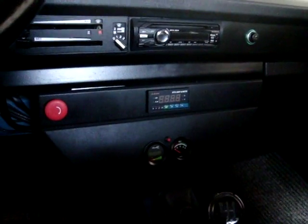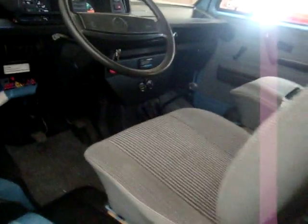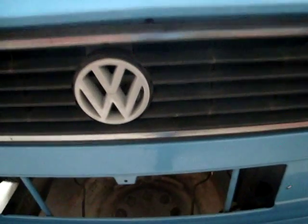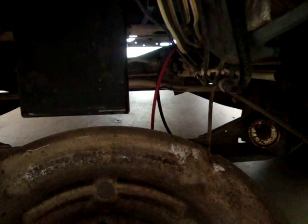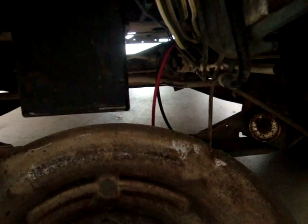We got the instruments in place, but we need to wire them up. The wires are in place — they just need to be attached. But some of that is going to require our pack voltage to the front. And so that's coming through those two lines, the red and black one you see hanging in the back there. That's going to come up here and then branch from here and go back just a short ways underneath the driver's seat to our DC to DC converter.